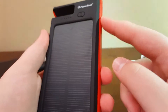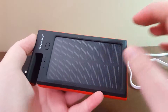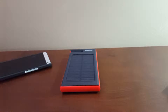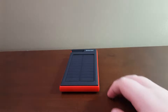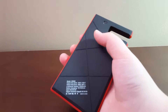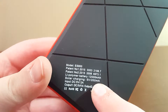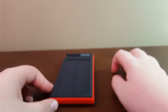Realistically, the solar panel is not going to charge your phone fully. What I'm thinking is you bring this along for a camping trip — you have it charged before you get there, but maybe you get lost, your phone dies, this is out of battery. Put it in the sun for an hour or two and you'll have enough juice to call someone to pick you up. Realistically it's going to take a long time — you only get a solar charging input of 200 milliamps, so I think about 60 hours of direct sunlight to charge it fully.